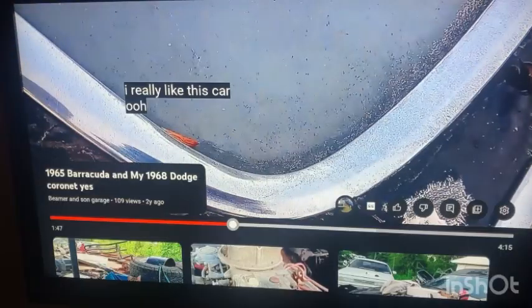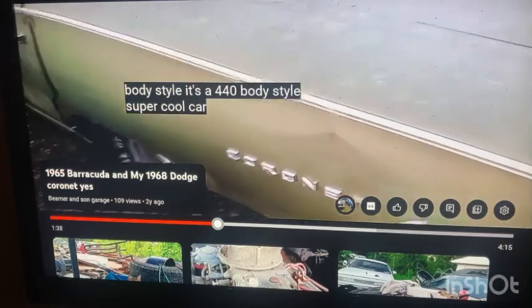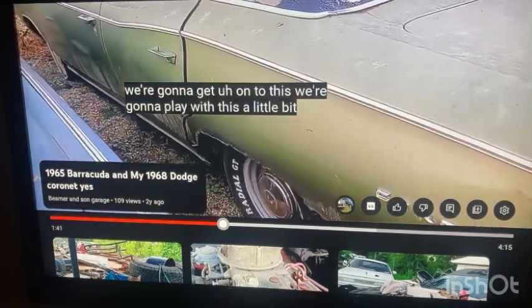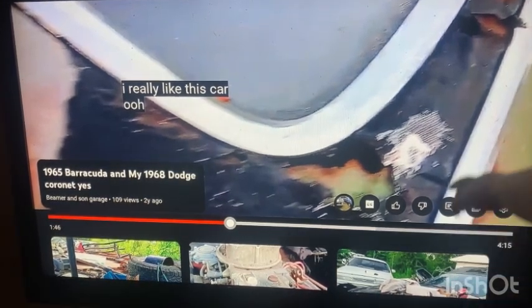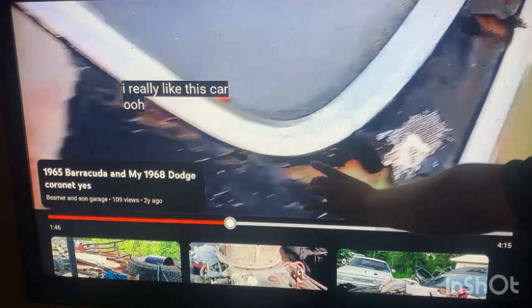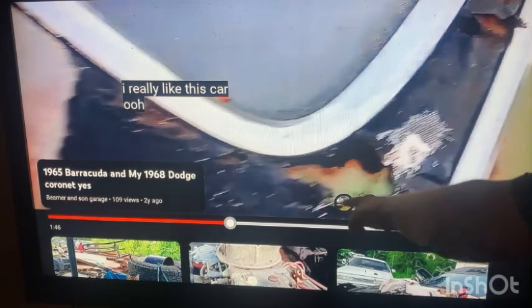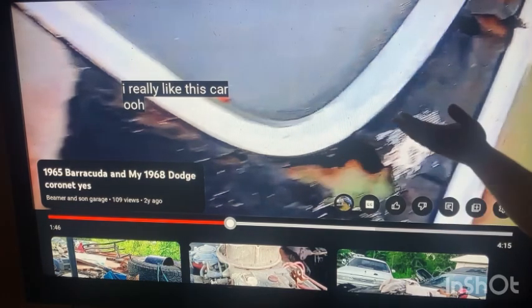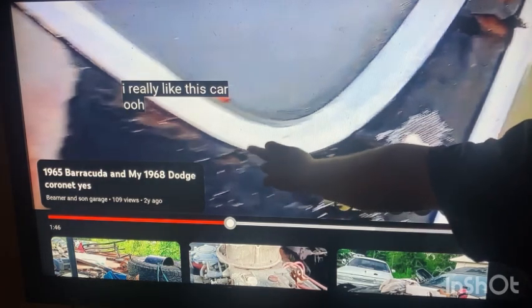Look at that. I don't know how many of you guys can actually see this, but when I back up — let me try to pause it. Right here, this thing is the sail panel. It's right out from the quarter section. Just follow the window up — so it's right up in here. You're thinking you can see the hole: here's your quarter, and then this piece meets your quarter, and then here's your trunk lid. That hole goes all the way up in here into your quarter section.